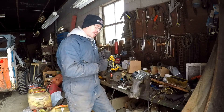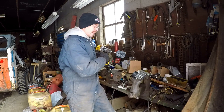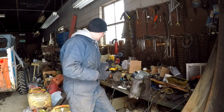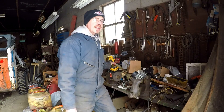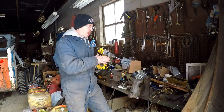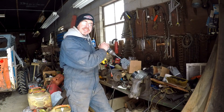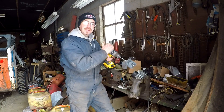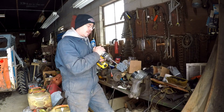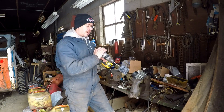I've got my cylinder here clamped in the vise at an angle that makes it easier to move the hone up and down. The first thing we want to do is not take our hone and just start jamming it in there dry — we're going to oil the hone and put a little oil on our cylinder walls just to lubricate it and help it go a little smoother. Before we start, a couple of things to keep in mind: do not stick your hone in and then start spinning it. Make sure you start with it spinning and enter with it spinning. Don't stick it in, start it, stop it, and rip it out — that's going to ruin your honing. You want it moving when you insert it and when you pull it out.